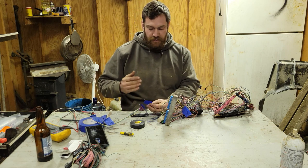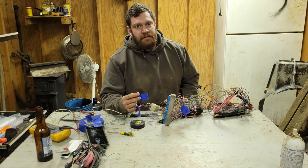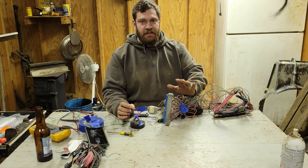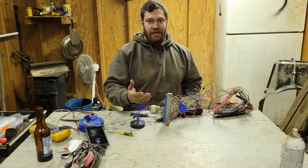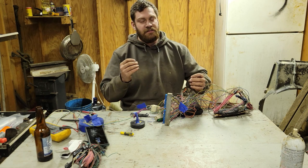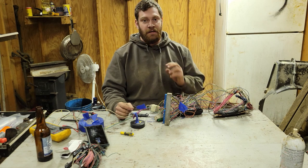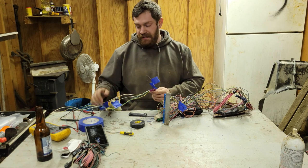let's use this one. Torque converter brake switch. So, what this is, this will go to a brake switch with four pins on it. So your original two pins will be for your regular switch whenever you hit the brakes, your brake lights come on. And whenever you hit the switch, it also cuts power to this. So one side of the switch is constant on, the other side of the switch is constant off until you hit the brakes. Well, the constant on is for your torque converter, so whenever you touch the brakes, it lets the ECM know that you have hit the brakes and to unlock the torque converter so you can slow down a lot more smoothly. So, it gives you a list of things like that, and like your fuel pump relay,